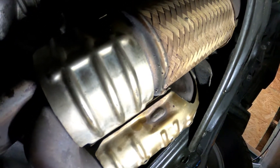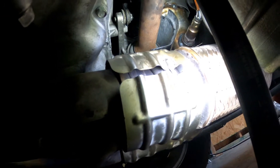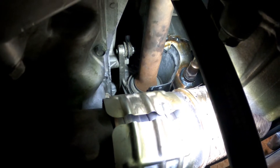Another thing: the heat shield is very large on these factory catalytic converters. There's a heat shield that wraps around the axle — three fasteners hold it to the jackshaft mount on the back of the engine. You'll need to get that off and spin it out of the way the best you can, to give yourself as much room to work around that catalytic converter as possible.